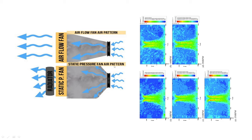Now, if you're running a radiator, AIO, or something like that, it doesn't matter quite as much, but the quality of the fan that you use does matter. The air temperature inside your case, meaning for non-heat generating components like your motherboard, is going to vary relatively little. But if you're water cooling your CPU and air cooling your GPU, you still want significant airflow going through your case so that your GPU has plenty of fresh air to inhale to keep it running as cool as possible. This is where flow patterns matter.